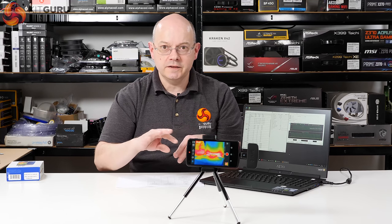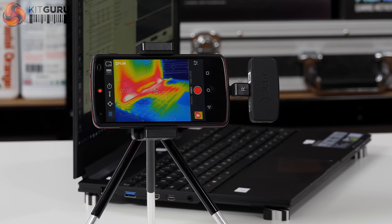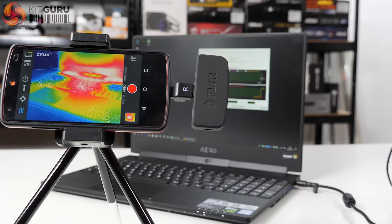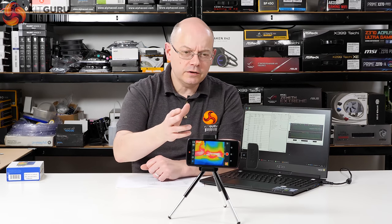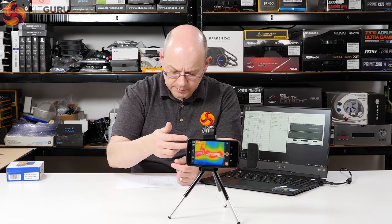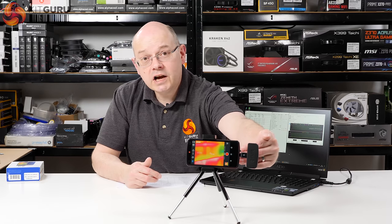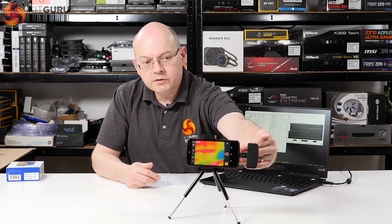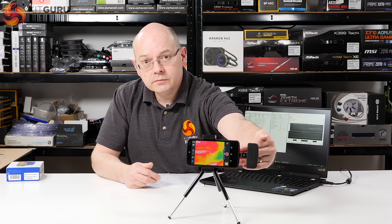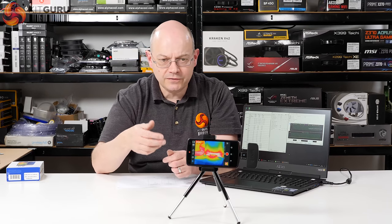It's not just a blurry colored map. The downside of the FLIR One is the color gradients look really extreme — parts look baking hot and parts icy cold, but they're not. This laptop is just idling; the range of temperatures is between about 20°C on the cooler parts and 30-something on the hotter parts. If I put my hand up to it — I'm officially a mammal — it'll read 34 or 35°C, but it looks far hotter than that. That differential can be deceptive.